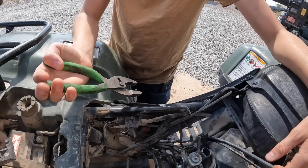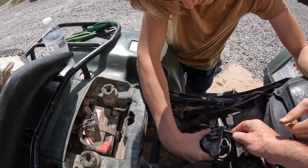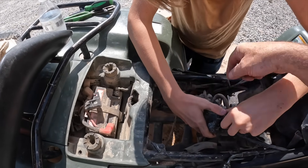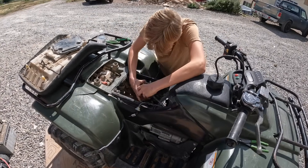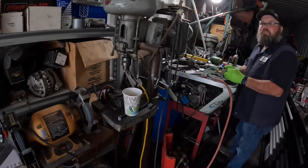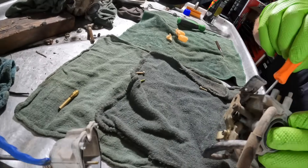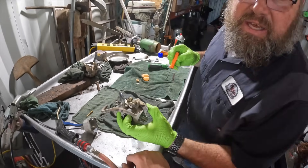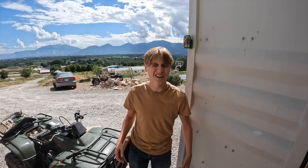Get the little bolts and take it off. Undo your choke, undo the throttle cable, pull it out. Dad has diagnosed the problem with the wheeler — we got crap flying in through the breather on the side. There's a whole bunch of junk going in through this breather hole. Gotta see what's in that hose — there's gotta be something.